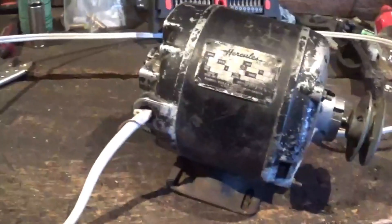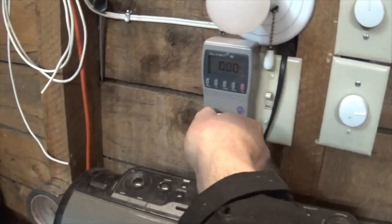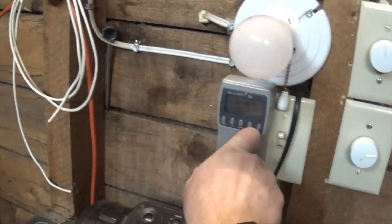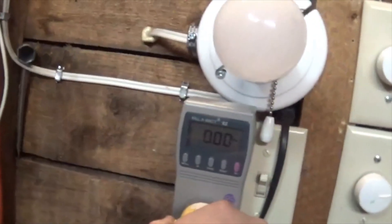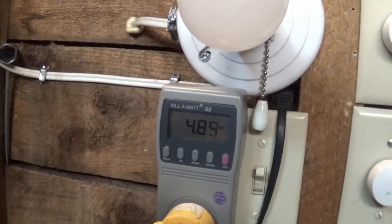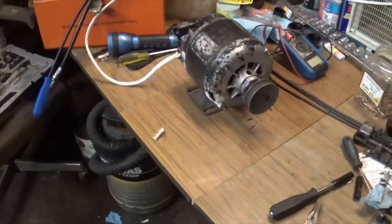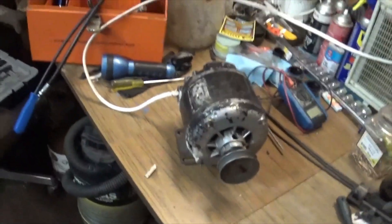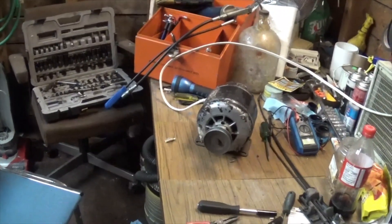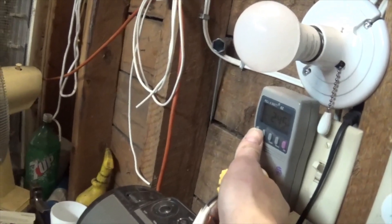That centrifugal switch is working - that is neat. I'm going to get my power tester, but we're going to take this to the shed now because we know it's not going to be shorted out. We're allowed to pull 5.8 amps. She's pulling 15 amps when she's locking the rotor. Right on - she's not over-amping with no load, actually a whole amp under its maximum with no load. That seems about right to me. Bearings do definitely have some play in them.